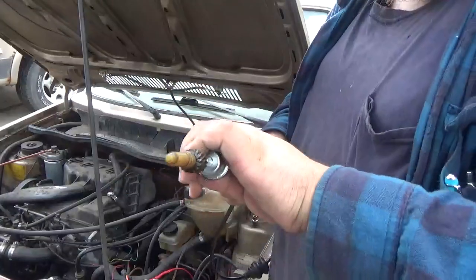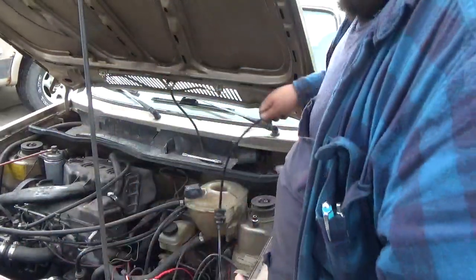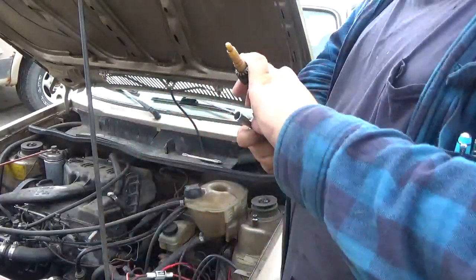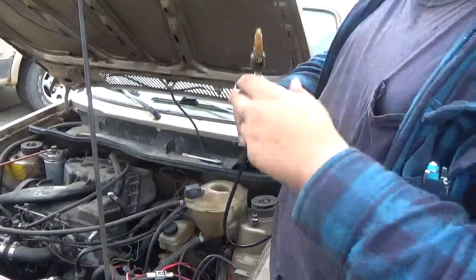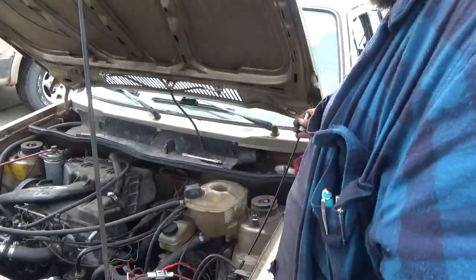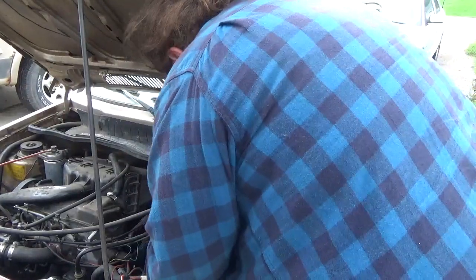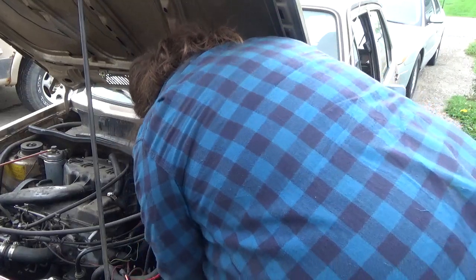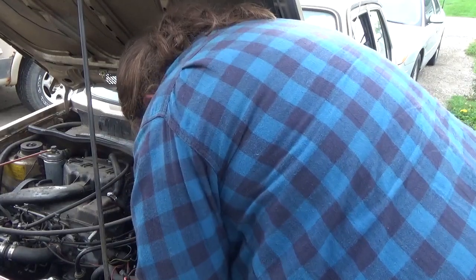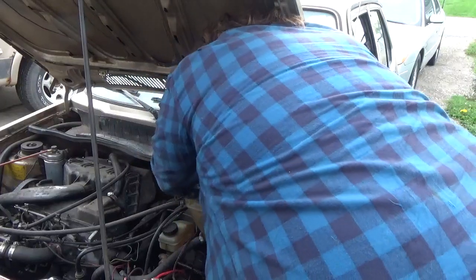Do not connect this end with the gear first. Actually, that's how I broke this last cable. So, yeah, don't do it. And if you are pulling the gauge cluster, pull the end off of your transmission, because these cables are very fragile. They love to break, and they are starting to become a little hard to come by, especially during this time of unrest with the pandemic. And that's another thing. I digress.